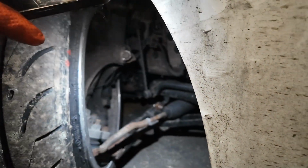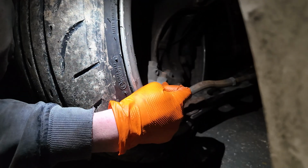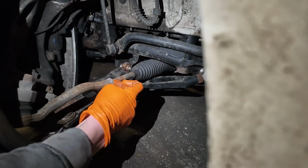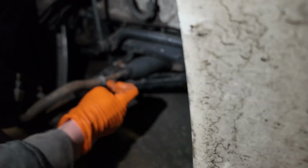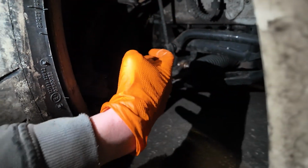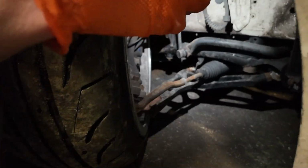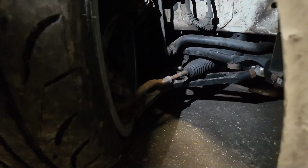So the steering wheel comes back every single time. You have to modify this mount here. You have to trim down the 240i inner and re-thread it further. You have to cut down the outer E90 because the rack on these are a lot wider and they have a different threaded insert. Yeah, it's still running drop links, so it handles really well.